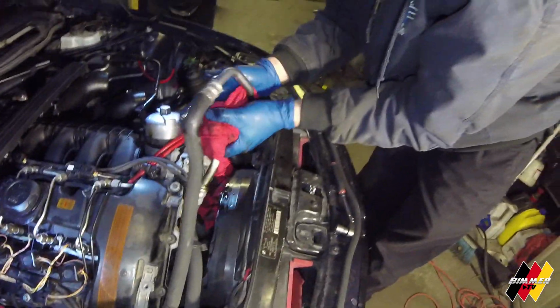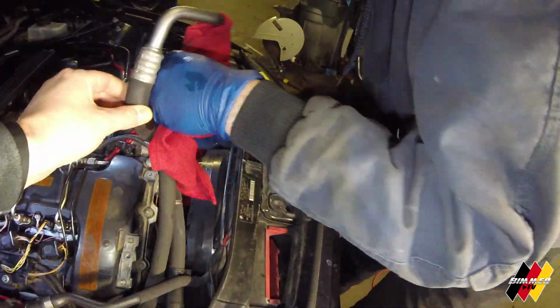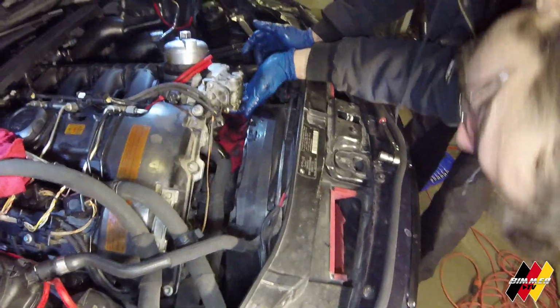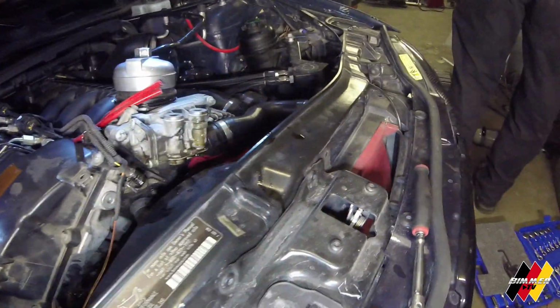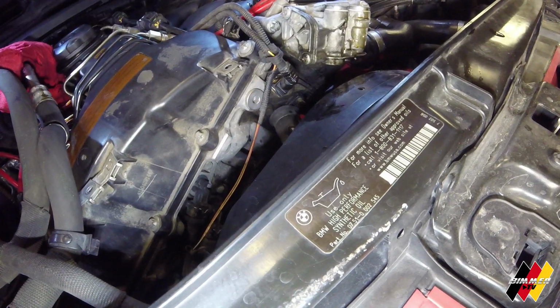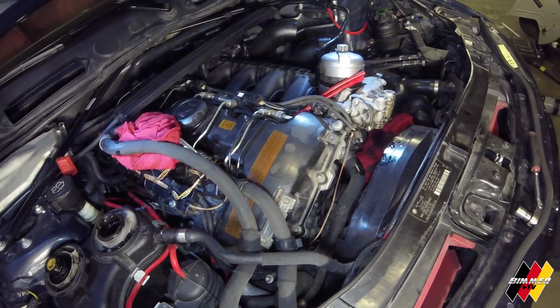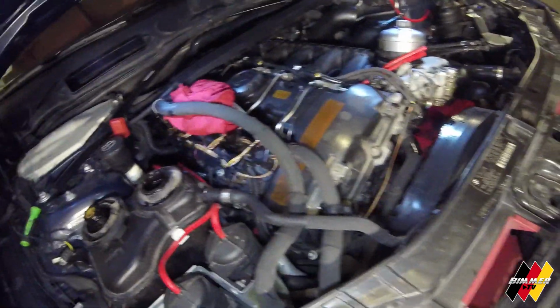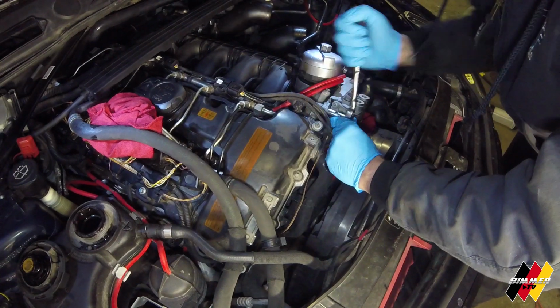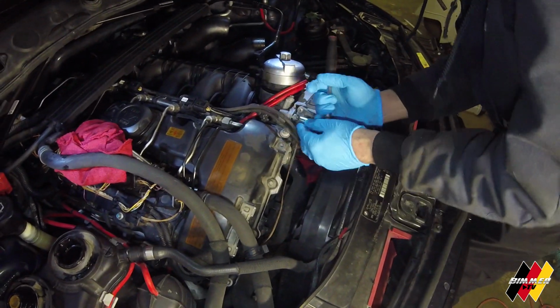Okay, get these out. This is why I keep rags. Mind grabbing me one more? So, next thing you're going to want to do is get the rest of the cooler bolts out. So it's these 2 inverted Torx. I'm going to change my gloves a lot on this one because, like I said, it's a kind of messy job. But looks like maybe this has leaked before or something, huh? It's pretty crusty under there. That's all from the oil filter housing. It looks like it probably leaked before, or is leaking now? That's from that, yeah. That will happen. It'll just kind of leak all down the side or the front of the motor.